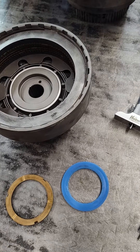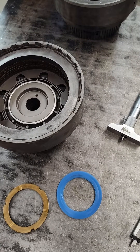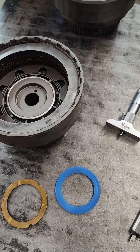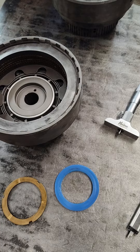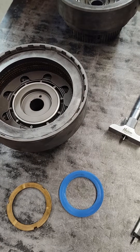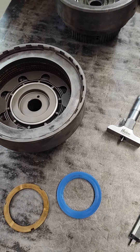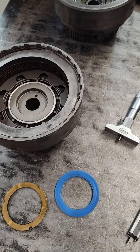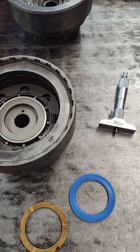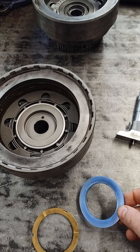I considered a lot of things — bronze was probably going to be my number one pick. But I've decided on this plastic, and it's a good plastic. It's a high-temperature plastic made for making washers and gears and things like that. It withstands transmission fluid, of course. Operating temperature is about 250 degrees max — and that's operating temperature, it doesn't melt at that. If you're operating your transmission at 250 or more all the time, you've got other problems. But this washer will withstand 250 as an operating temperature.